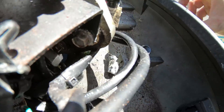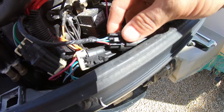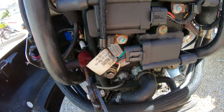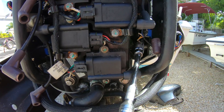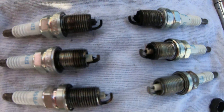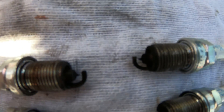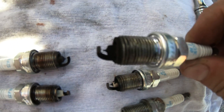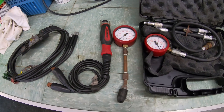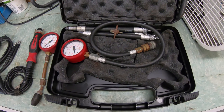Also, be careful with the wires in the front here, and don't forget to disconnect the trim switch. Now we can carefully remove the spark plug wires and then the plugs. Pay close attention to what they look like and what cylinders they came out of. On certain models, a couple of the ignition coils will need to be removed to get them out. You'll need a spark tester and a remote starter switch for this, but we'll start by checking spark and compression.